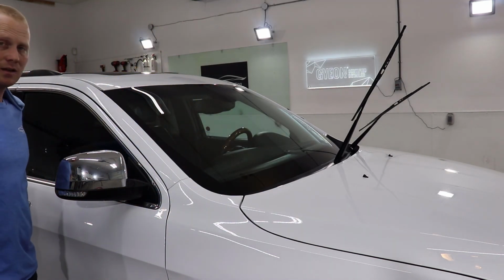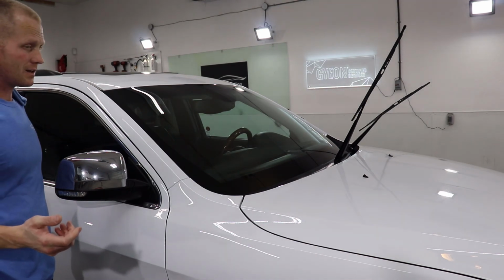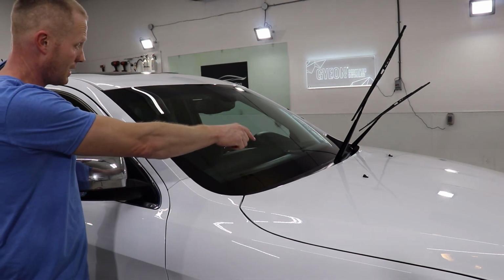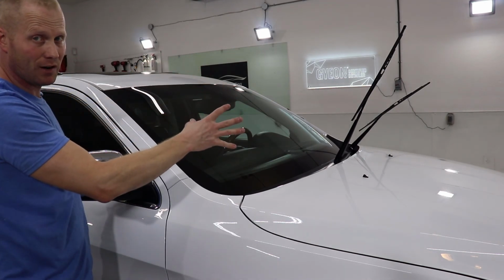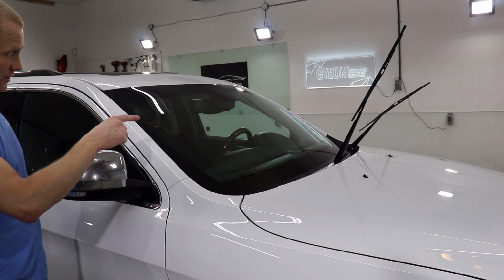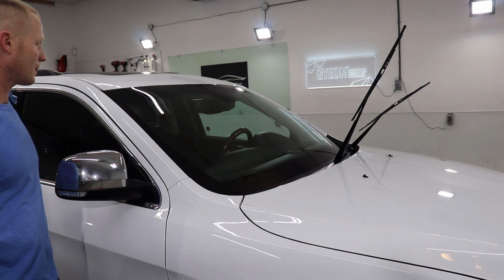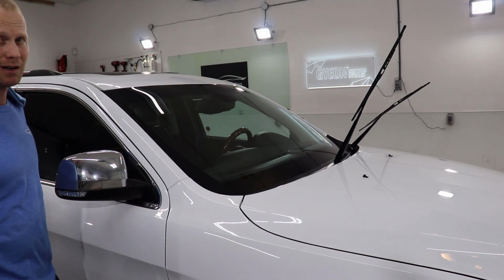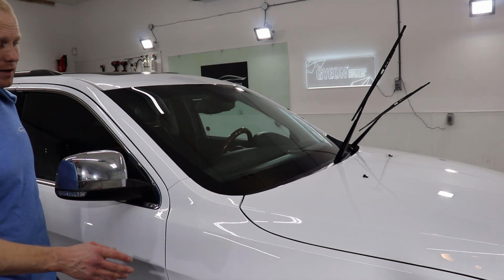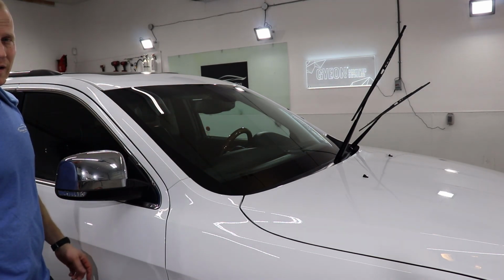And that's that. So if you don't do these all the time, it's always a good idea just to get out a handheld light and go over the windshield from a bunch of different angles, or get inside your vehicle, pull it outdoors, and just look for streaks, because it's something where it takes an extra 2 minutes, but it'll save you a headache if you have streaks all over it, especially into the corners, because it can be tough to get in there with polish and that kind of thing.